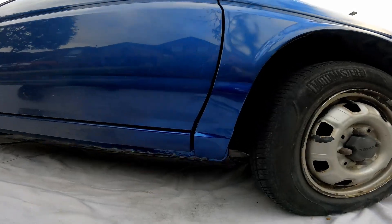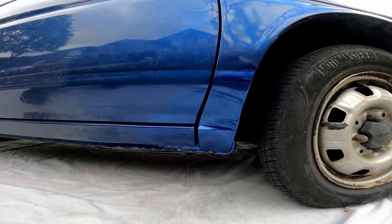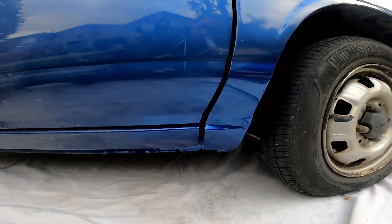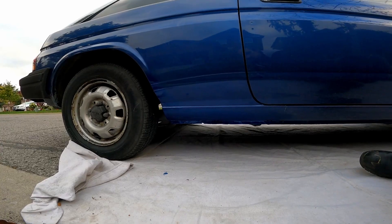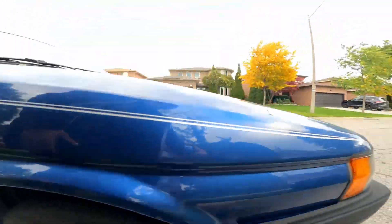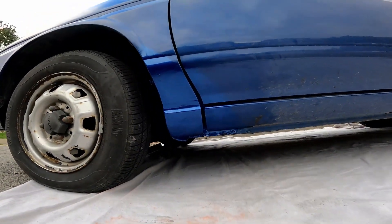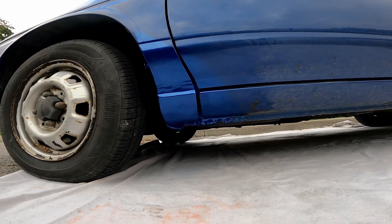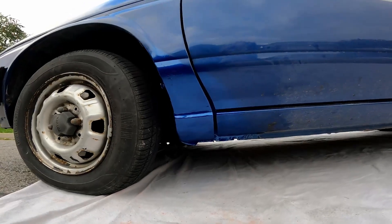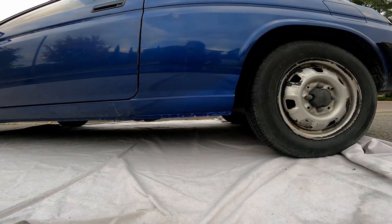Here's pretty much the finished product. I just have to put the fender back on and reattach those screws. It actually turned out well — the color is off, hard to match an '89 to herself, you can really see it here, color is just slightly off but really close. I didn't do too well on the form on this side, but over here I feel like I nailed it, she looks pretty good. I'm just gonna wait for this last clear coat to dry, put the fender back on, and then in a couple days give her a good wet sand and a buff — and that will be her, freaking sweet.